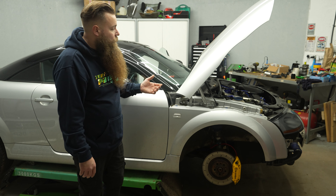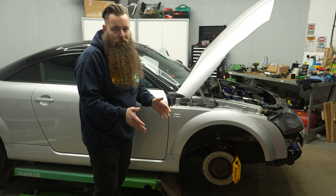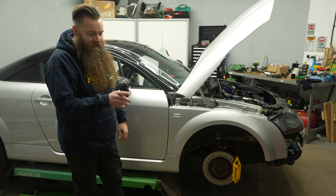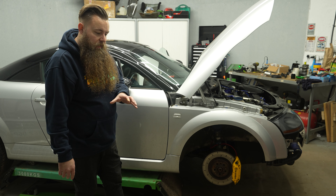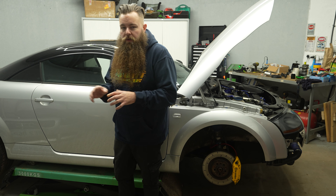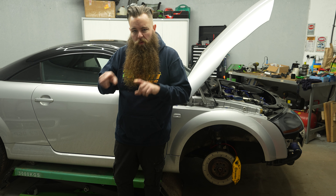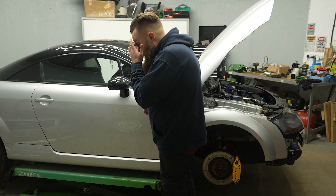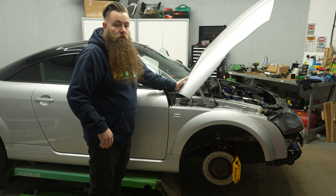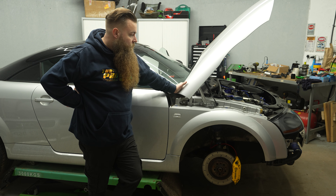The meth - if I can bring the air intake temps down and get a few more horsepower, it's going to be better for the engine rather than running really hot. And of course the shift tower, because the shifting on that is amazing. Since driving this without it, I feel like I'm leaning down to get to the gear lever, which I don't like. Relatively straightforward fit, I just need a bit more finesse to get it in and cut around it. I need to sort out how to fit the meth on the rear seat delete, mock it up and work out where the pipes are going so I can get a nice sweep. I don't want to kink them. I also need to finish the under waxing, there are a few bits of bodywork to address, a cracked windscreen to get replaced, and the scuttle needs changing - but I've got a new one. Loads of little bits.